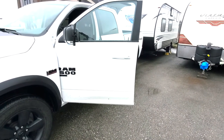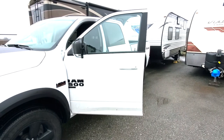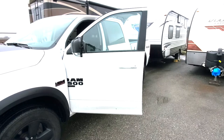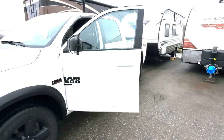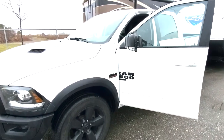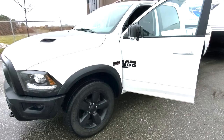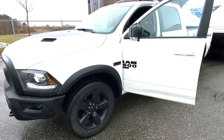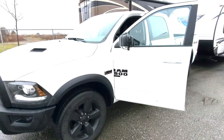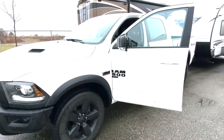As a little experiment, we hooked up my in-laws' van to the trailer. I used to tow this trailer with a 2017 Dodge Grand Caravan, and everything worked perfectly — which was very confusing. Then, experimenting and troubleshooting, I hooked up the truck to a few other trailers that belonged to friends of mine, and in each case the lights worked fine and the fuse didn't blow. I was left scratching my head — why would the trailer work fine on the minivan but not on the truck, and why did the truck work fine on other campers? The mystery deepened.